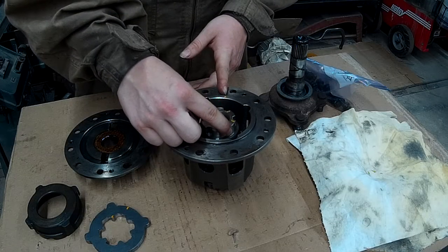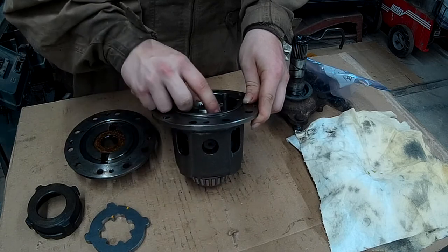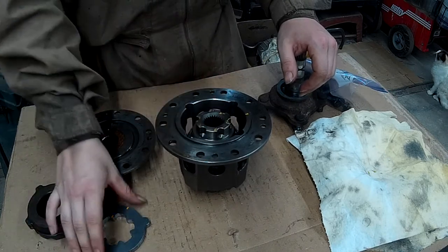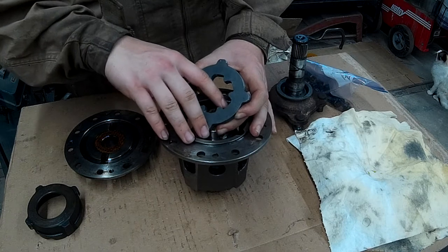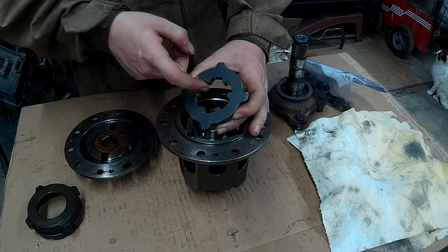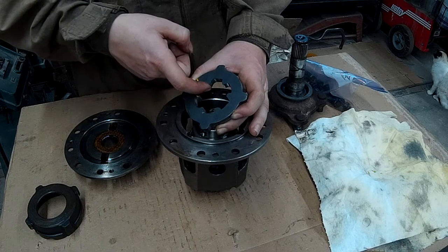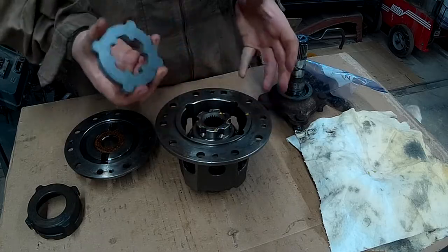This moves slightly up, but what's happening is it's pushing this little piece in there. I don't know if you guys can see that. It's pushing it this way, and it needs to be solid. So what I'm gonna do now is weld to the back side of the grooves that we cut. We cut the inside pieces, so now it's got this hook design, and now we're gonna weld on the back side. We're just gonna add some weld just so that this stops playing.